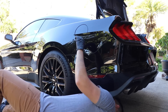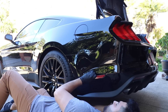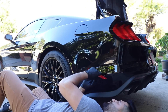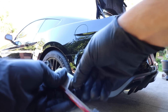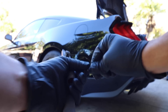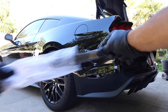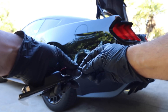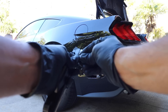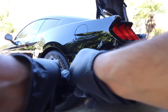It's super simple to do — all you've got to do is go underneath the car, find the marker, and just push it out, just like so. It comes right out, super simple. Then you undo the connector right here — done. Once the connector is unscrewed, you just twist the bulb out just like that. There's your bulb. You want to take this out of the base, and the new LED side marker plugs into this base. Here's our new LED side marker — take it out of the packaging and plug it into the little ball base end.